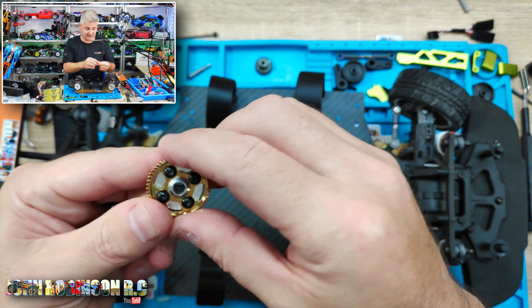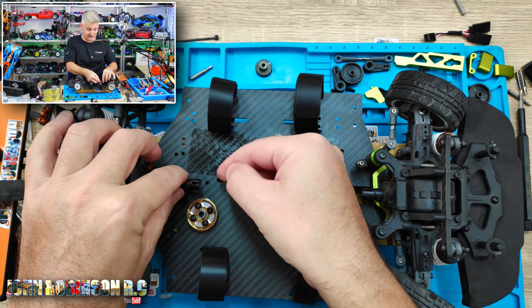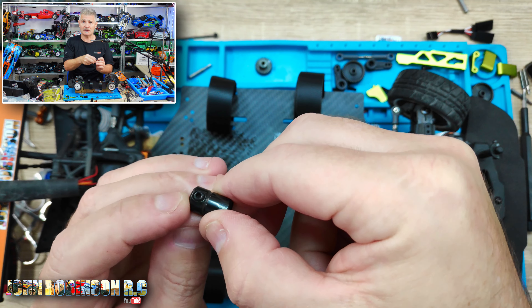So that is the old one, this is the new one. This is the one that goes into the center drive shaft — I did burn off the thread lock there as well, just to make it easier to put back into position. We have this is the old pinion again — I just burnt off the thread lock in case I need to use that in the future.